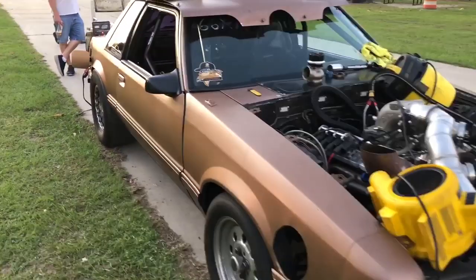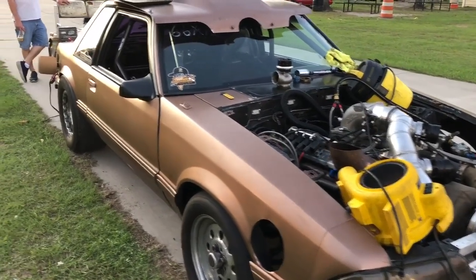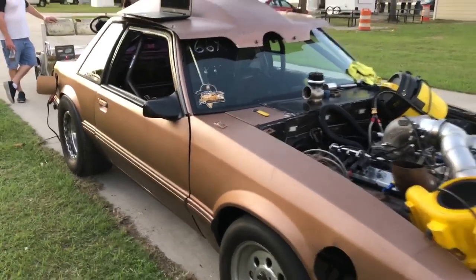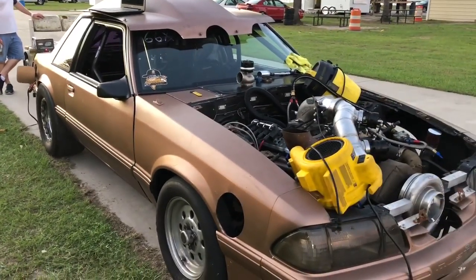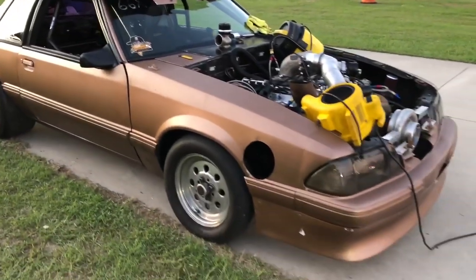So I just got under there and readjusted the anti-roll bar the same way it was earlier at Galot, because down track I was having to steer it pretty hard to the left. It was trying to cross the center lane. Me and Shannon both, he shook the tires also. The sun just got off the track, so the track wasn't going to be great. It's just one of those things.